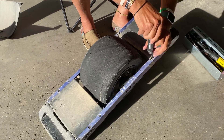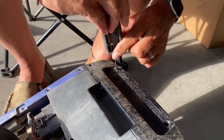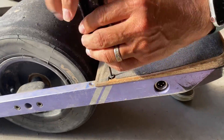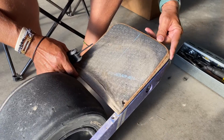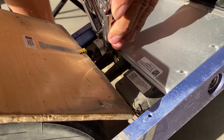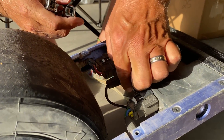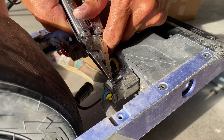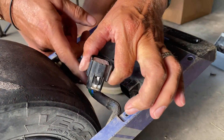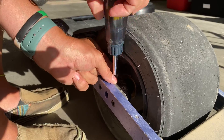We're going to start on the controller side. We remove the access panel to get to the cables, remove the bumper on that side as well, flip the board over, and loosen the weight sensor foot pad. Then we disconnect that weight sensor foot pad from the controller — you loosen off the cable and pull it off. Pretty straightforward. Same thing with the controller cable and connector. You have to be careful with that white connector: pull it out and then just pry it off.